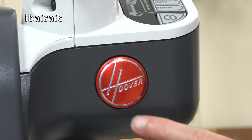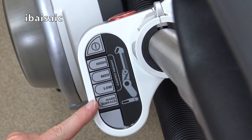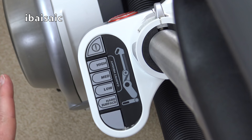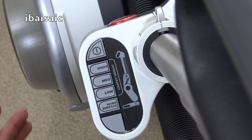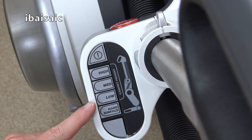I absolutely love this large Hoover logo on the front of this machine. Down here we've got the control panel: the on/off switch, the carpet height selectors, and the hard surface button. The hard surface button will turn the brush roller off, so this must have two motors. High, medium, and low will automatically adjust the wheels underneath to raise or lower the head for high pile, medium pile, or low pile carpet.